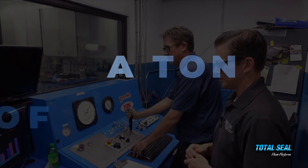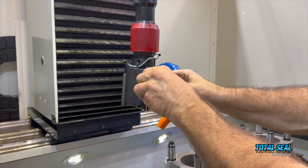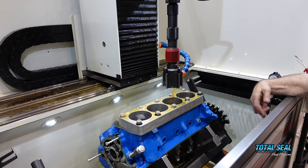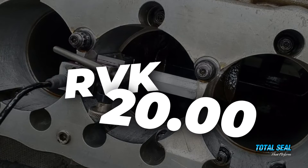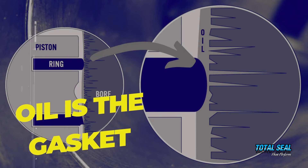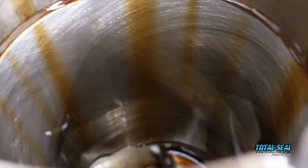That's why we talk about this so much — there's a ton of power and a ton of durability on offer if you get the recipe right to make good ring seal soup. The key is making sure you get the correct hone that has enough valley in it to hold the proper amount of oil depending on how much fuel you put through the engine. The RVK — that's the valley that holds the oil — on dad's engine when it came apart was down in the 20s. Very low. When we re-honed it, we had it up to the 50s, holding more oil. Oil is the gasket and the lubricant, giving better ring seal through those deeper valleys.